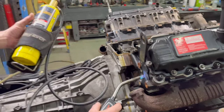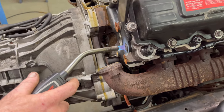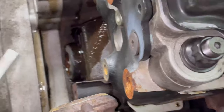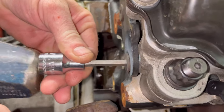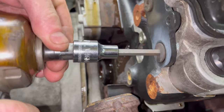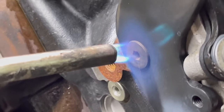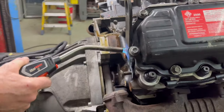It's got a little heat in it. It's a six Allen, which I wouldn't mind having a short well, but all we have is a deep well. A couple of smacks and a big impact — let's see what happens. No sweat. Chances are very, very good that you will have maximum success if you just use a six Allen half-inch drive with an impact. They work on the front too.